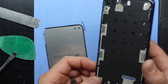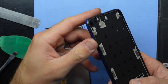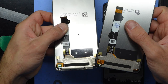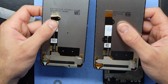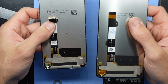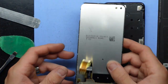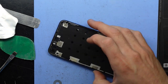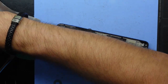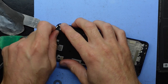Next up is a bit of prep work. I need to remove all these little glass shards — might even take this completely off if it lets me. I will need to re-glue that, which is fine. I'm just comparing the parts — they look pretty much the same so we're going to be fine, no real major differences. Hopefully this is relatively close to an original display; going by the model number on the bottom we're pretty close. Next up is clearing out the glass using tweezers and a flat head screwdriver, and I should just be able to work around the outer perimeter.